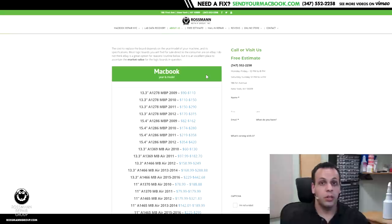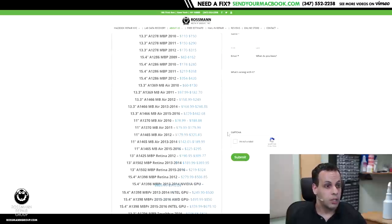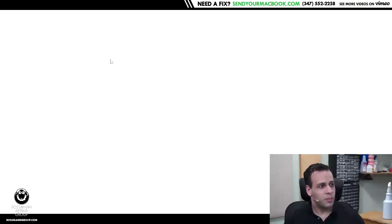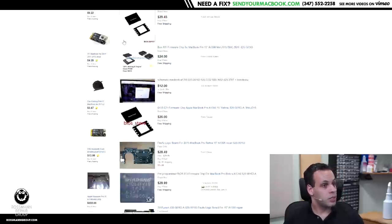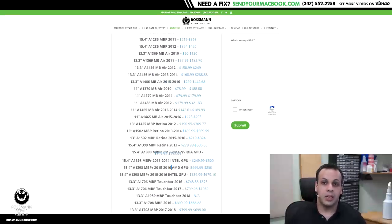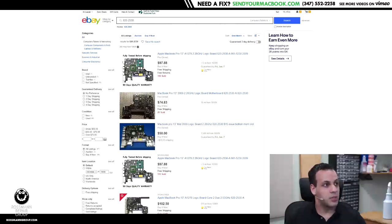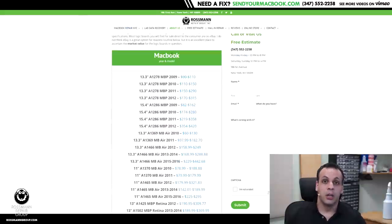Should you fix the board or replace it? This is subjective but depends on the cost of repairing versus replacing. If you have one of the 2015 or 2016 1398 Retinas where you're paying maybe $850 to get the board replaced, and your only issue is an LCD connector or a backlight fuse, then repair is obviously going to be the way to go because it'll be cheaper. However, if you have a really old board like a 2009 A1278 that's randomly crashing or completely dead for a complicated reason — a signal not coming on from the CPU or MCP — that's probably not going to be worth repairing.